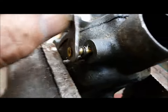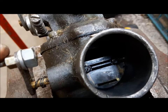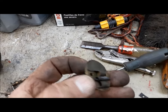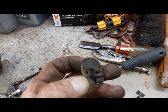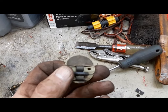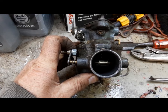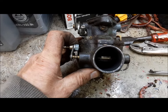We're going to try to straighten this little pin out and get that fixed up. First, I'll try to get this choke plate fixed up with the right little valve. Here I've got a proper choke butterfly and I can install that in. When the engine first sputters to life, it pulls that valve off its seat and lets it get some fresh air so it doesn't end up over-fueled. There we go — now when the choke is open, it's open.